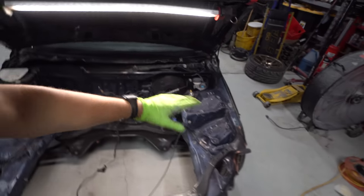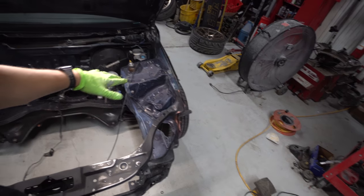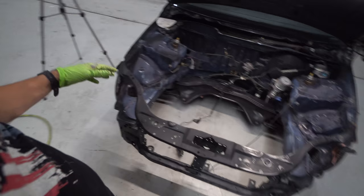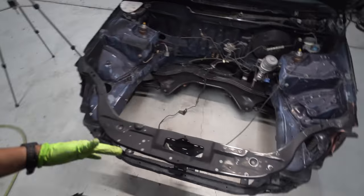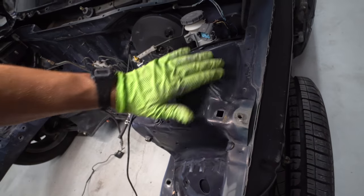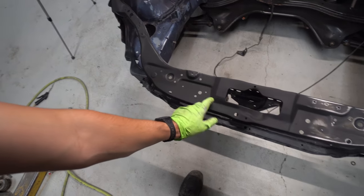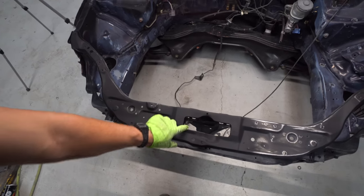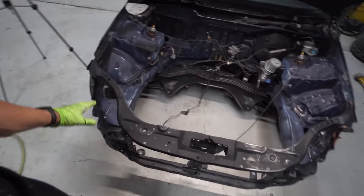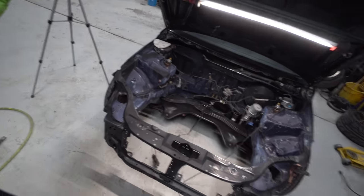Yesterday when I was pressure washing the engine bay, I basically took some scuff stuff and some red Scotch-Brite and Scotch-Brited everything. Today I grabbed the DA with some 320 grit and some 400 grit and just buzzed some spots, some little scratches, to smooth them out and clean that up. There were a couple of things we didn't really need right here that I just filled really quick with some icing, cleaned that up, threw some quick high build primer on it, and let that sit up.